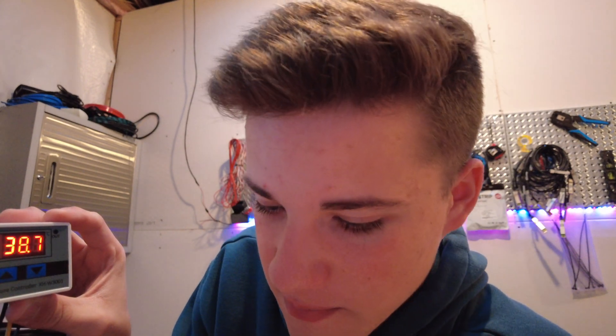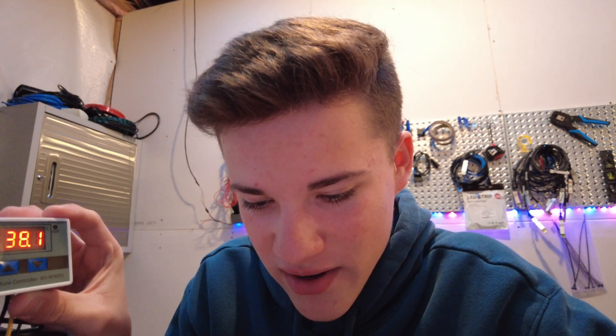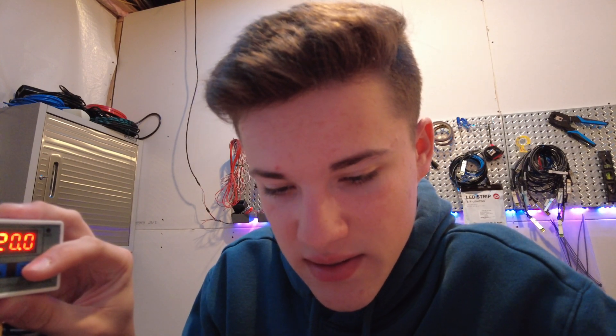Let's take a look — if we lower this down, we'll say minimum is 19°C. Holding the other button, I'm guessing the maximum will be set there too. It's really odd that there's a minimum, because you should just be able to set a maximum temperature — if it's not at the maximum it should be running to get there. I entered 20°C which is actually 68°F, so that's way too hot. I don't need it to be 70 degrees in the box. I'll go to 15°C and set the other temperature to 3°C as the minimum when it kicks in. So it needs to stay between that range — if it goes below that range it should heat up, and if it goes above the range it shouldn't do anything. I hope.